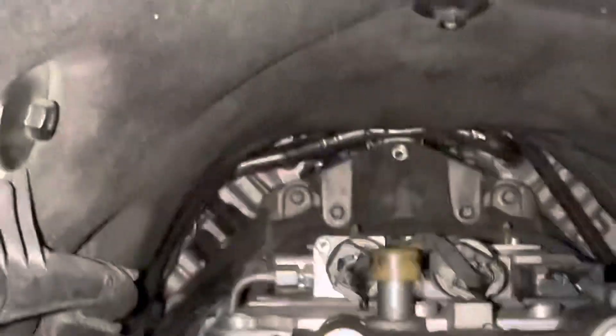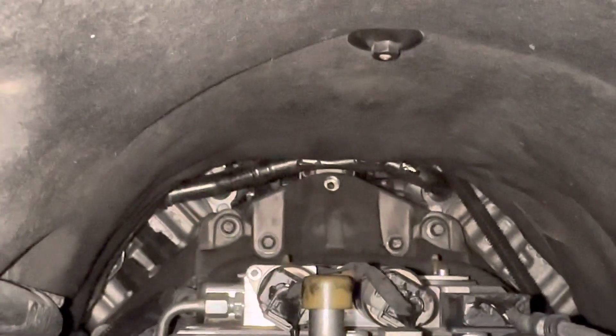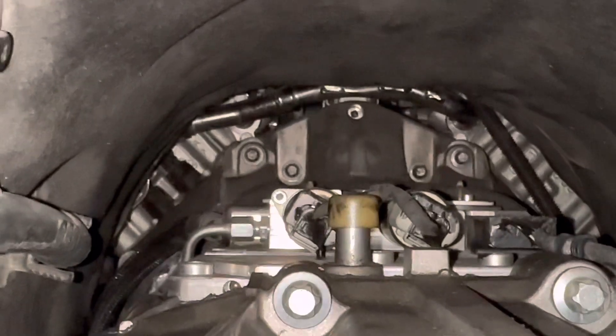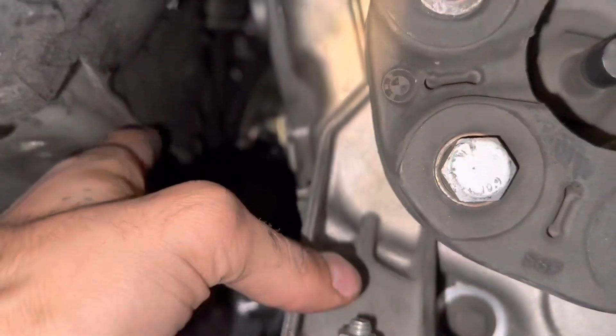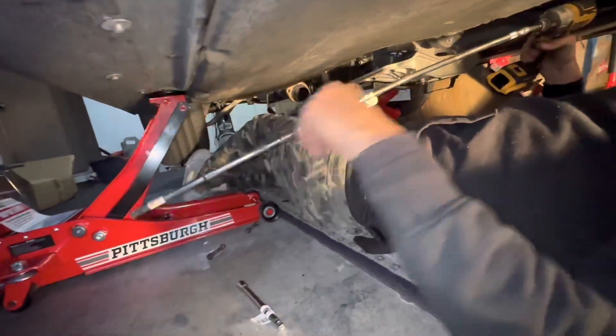You've got bolts one, two, three, four on one side and the same on the other side. There's also a starter bolt on top. Remove all those bell housing bolts — four up top. On the side, reach down using six or seven extensions or two long ones — there are four bolts down there too. Do the rest from the bottom, so that's six total on each face.